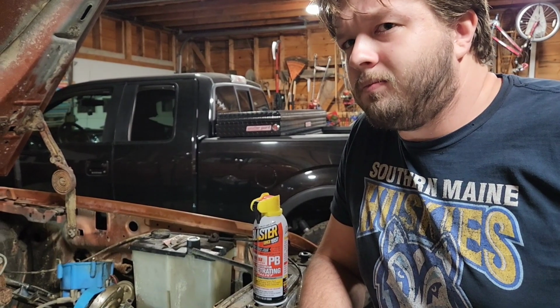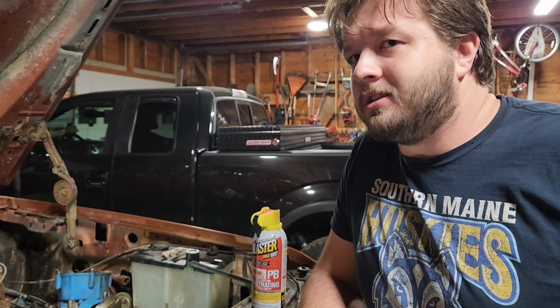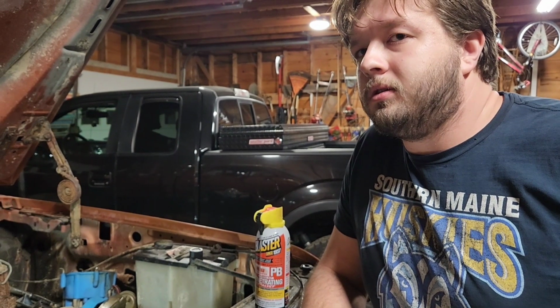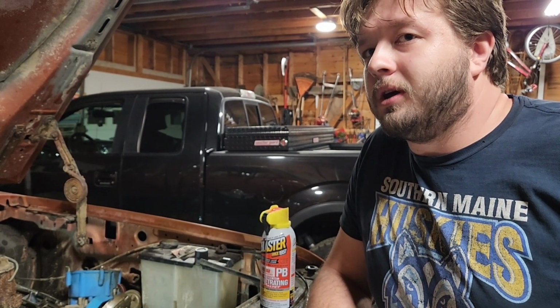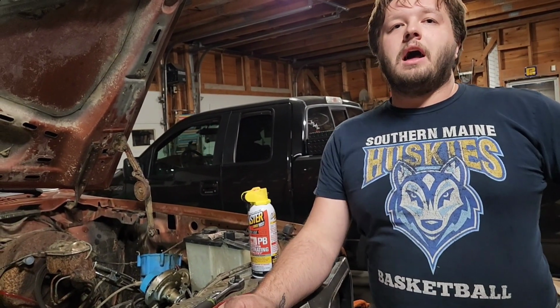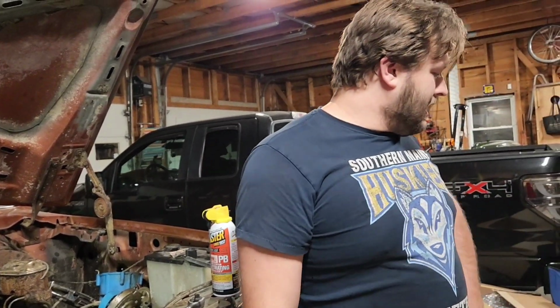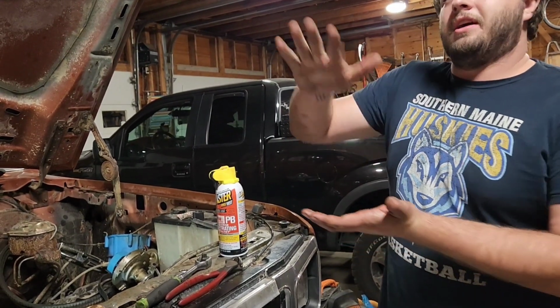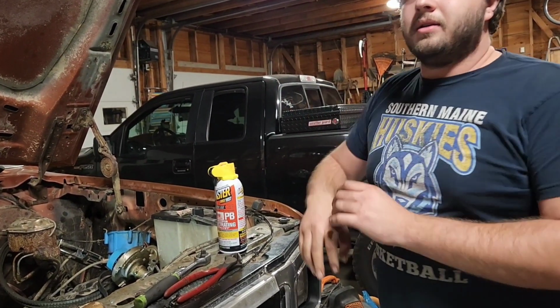Do I have to submerge the tappets in these? I don't think so. They are hydraulic, but it's a solid hydraulic. I don't think I have to. I would look up the specs just to double check, but I would assume not. The other thing I'm gonna do is put the push rods in. I am gonna press the push rods down a little bit just to move them.